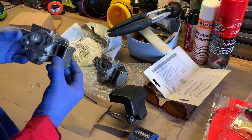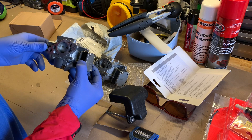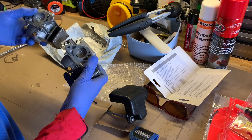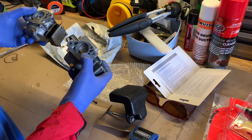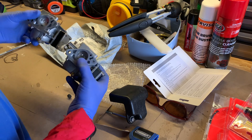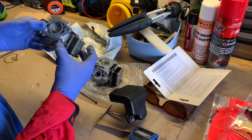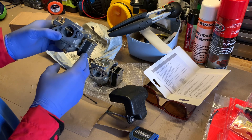So this is the old carburetor which I've just taken off. There are two clips under the fuel line, two bolts — the whole thing comes off in about half a minute. Here's the new cheap Chinese one, and I've got to say it certainly looks the goods. I checked the bore — it's the same. The gasket lines up okay, and size-wise it all seems to be a retrofit model. We'll stick it on and see how it goes.